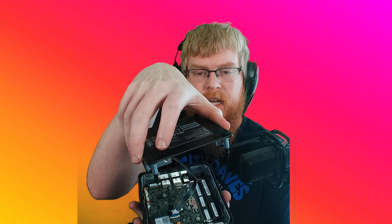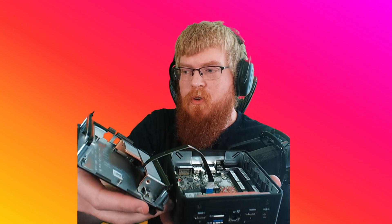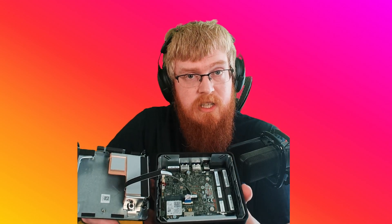Pull this up. There are two models for these: the slim and then the tall. This is the tall — I wanted the tall one because it's got a little more airflow and it's a little bigger inside. Plus there's a metal part where the solid state hard drive sticks into. The thing you've got to be careful with the tall model is there's a ribbon cable that connects to the hard drive bay. We're not going to be using that cable, but you don't want to yank it and rip it off. Just hold it off to the side, then put the parts in.